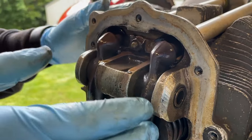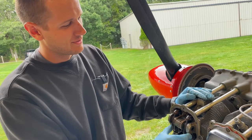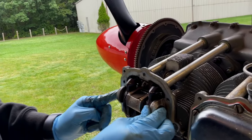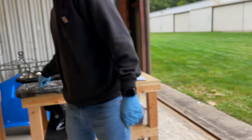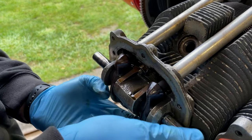No obstructions — we're ready to start actually taking the cylinder apart. First, we're going to pull out the rocker arms so we can take out the push rods. To do that, thankfully it's literally free-floating. Since my finger's not long enough and strong enough, just take a socket or something and push it.